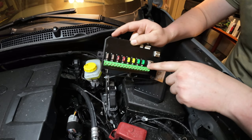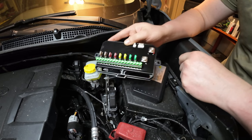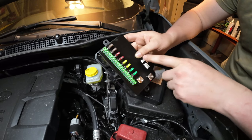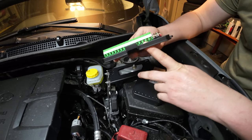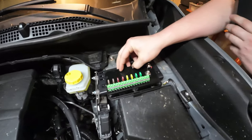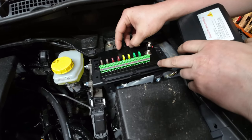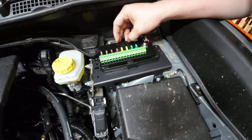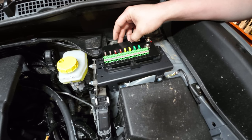If a fuse does burn out, there are little red LEDs in between the green terminals and the fuses themselves that turn red when it burns out — pretty nice for diagnosis. There's main positive, main negative, and then your control panel connector, plus one for changing the brightness. The wires that go into the positive and negative terminals travel up through a little gap. You have to mount it in the far back position — the third slot — which opens up a slot to run your wires to each channel and avoids blocking the fuse box.